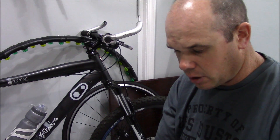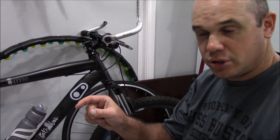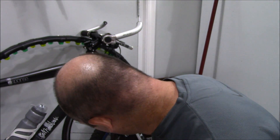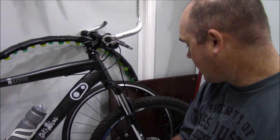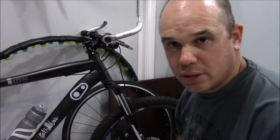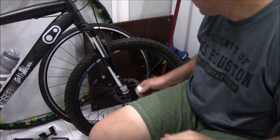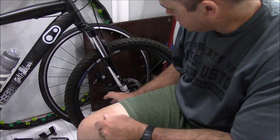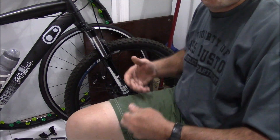Got back home and readjusted. I had to gap them a little bit more using a machinist gap gauge. I took the bolts off the calipers and pushed them in a little bit more inboard towards the spokes, which gave a little bit more room. That means I'm not going to get as much adjustment out of the brakes — this inner screw here adjusts the inner pad, and the outer pad is adjusted by the cable tension screw since these are mechanical disc brakes.